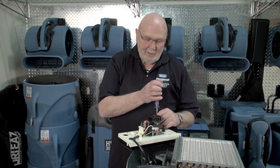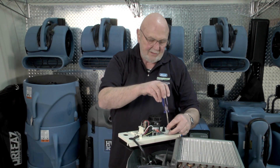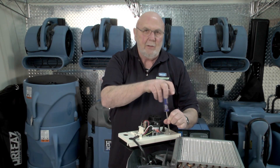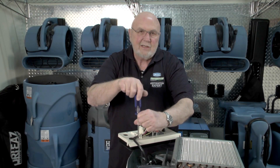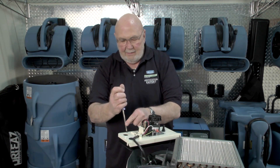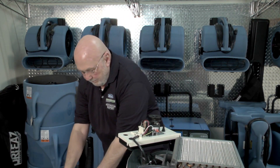The next thing I do is remove the basin of the pump — there are four screws that hold it in place. Just so you know, anything that comes into this unit and gets by the filter — dust, dirt, insects, carpet fiber, whatever it is — is going to end up in the basin of the pump, and it does need to be cleaned periodically.